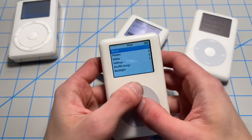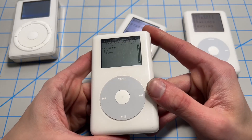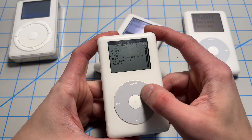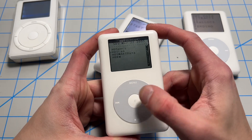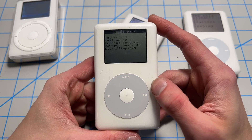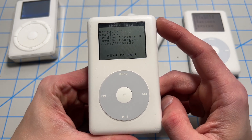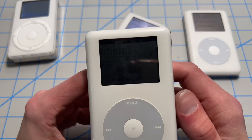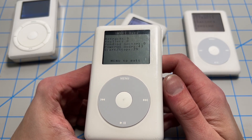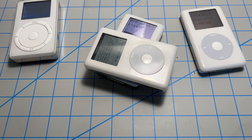On the photo here, there is certainly a more robust diagnostic mode. You can simply hold center select and previous track and we're in. This is the modern diagnostic mode, seen on the 5th, 6th, and 7th generation. We can run smart data — you get a little more information on the photos, such as power on hours and start stops. This hard drive is in excellent health: only 43 power on hours, 29 start stops. The reallocations and the pending sectors dictate the hard drive's health. These hard drives are rated for about 40,000 power on hours, which is give or take five years of constant initialization.